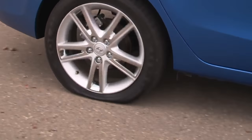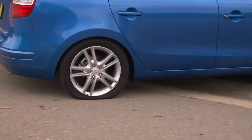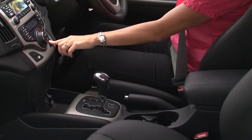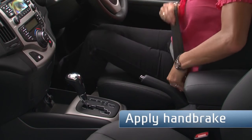If you're driving when you notice a problem with your tyre, gently slow down, stop in a safe place, and make sure that you park the car on solid level ground as far away from the road and passing traffic as possible, and put your hazard lights on. Apply the handbrake and put it in first gear if you're in a manual, or park if you're in an auto.